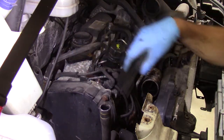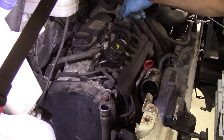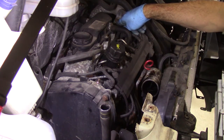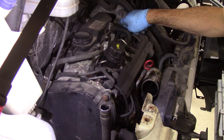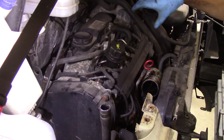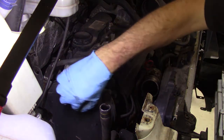Right, so with the engine mounting off, the next thing to take off will be the cam belt cover. It's worth noting on the top of the cam box at the far end, above each of the 2 cams, is a little screw plug, socket head cap. The proper way to do this is to remove those, and in the timing toolkit there's 2 pins to lock the cams. The idea is you turn it to the timing position, put the pegs in to lock the cams, put the peg in to lock the crank, and there's another peg to lock the pulley here.